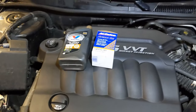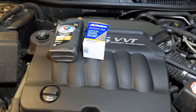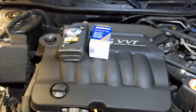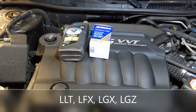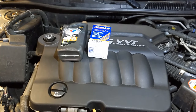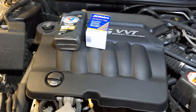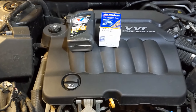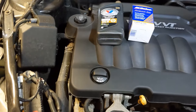I have a 2012 Chevy Impala. This motor can be found in countless GM vehicles and it went by several different option codes. This one's called the LFX. There's an LGX, an LLT — I'll post a link to Wikipedia for the rest of them. Anyway, these engines are starting to age and people are starting to have problems with them, mainly timing chain stretch issues.